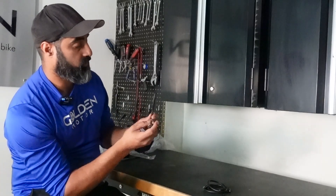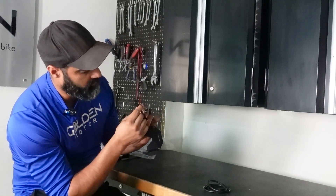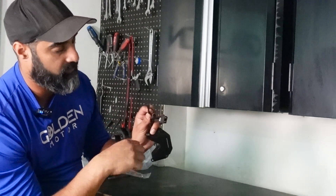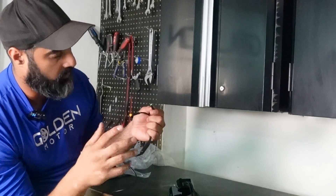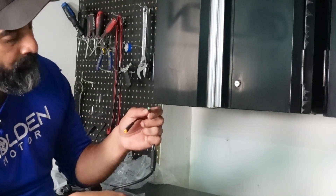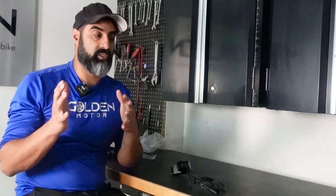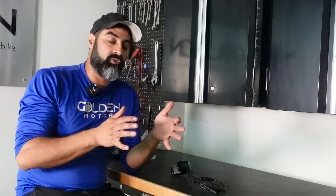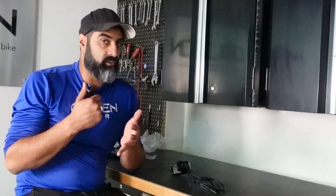The Gen 2 is using a CAN bus protocol to communicate. You can see the wiring harness; the speed sensor is shaped like a trapezoid, and the main wiring harness connector has a unique five-point shape for the display — that plug is used for CAN bus exclusively. Generally when CAN bus is used in different kits, it means the manufacturer restricts you to their battery to lock the system down. But CYC thankfully has not done that, so you can use any battery you want with the kit.